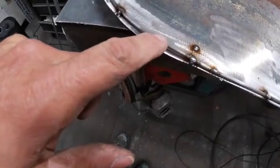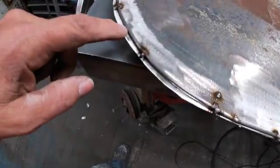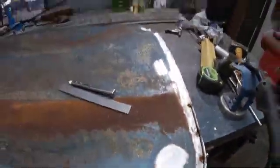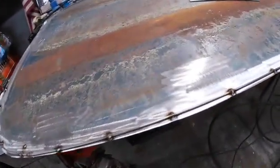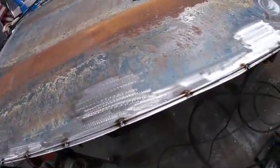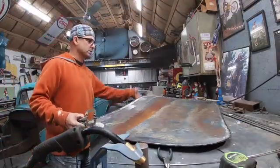So what I'm doing is I have my 3/16 inch rod here. I just put one section. This is a 4-foot section. I didn't want to end it on the bend, so I'm trying to end it closer to the straight edges. But I went around every like 3 inches or so, just tacked it. Just again to keep some integrity. I left a little bit of extra material. I'll do a little more on this side over here.